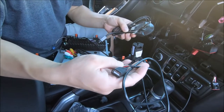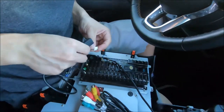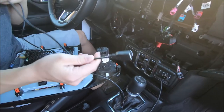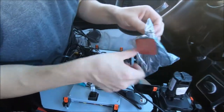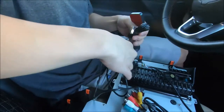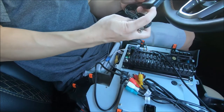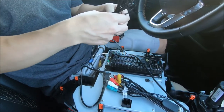In total you have three USBs — you have this one right here that connects on the back of the radio. That cable should be long enough to route on the kick plate of your vehicle or in the glove compartment for access. You also have the GPS antenna. This is an external GPS antenna, but we already have some type of adapter here — this allows you to connect your factory GPS antenna if you want to use the factory one. In this case we'll be keeping the external one and screwing the 4G antenna onto here.